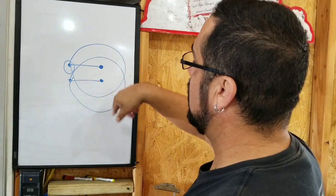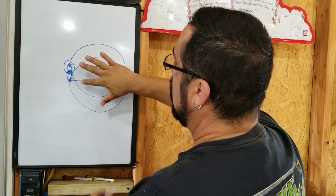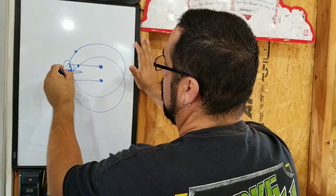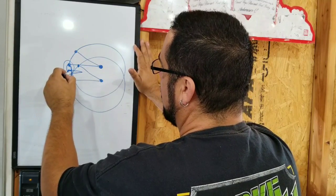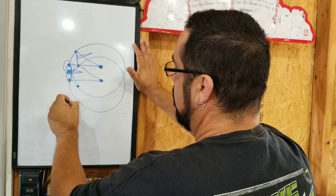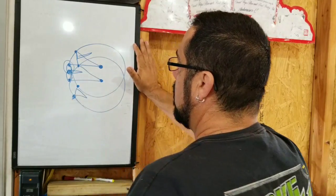Basically, you have to think about these circles and where everything is going to end up. If you have your axle in between two link tabs that connect top and bottom, that's your four-link. When you drop your suspension, the suspension comes down and this stuff goes up. If you set your pinion angle at a certain point and then drop, everything changes — now you've got a straight point between here and there, and it's going to be pointed this way.